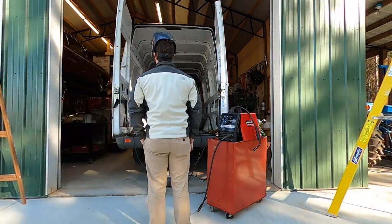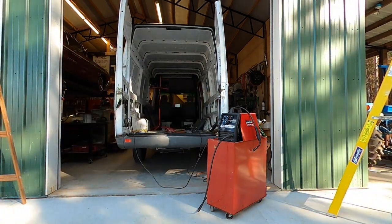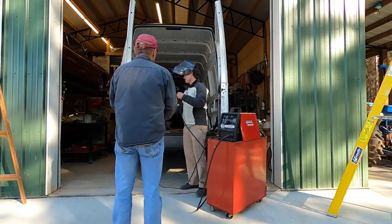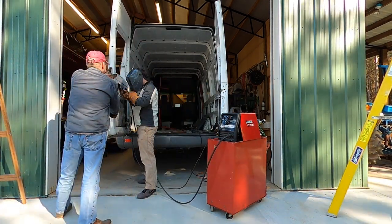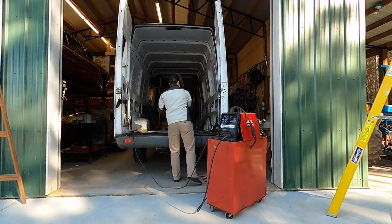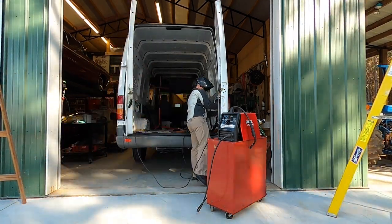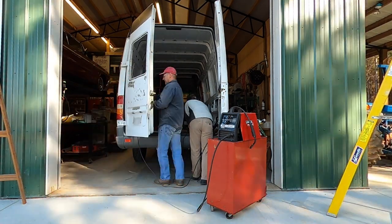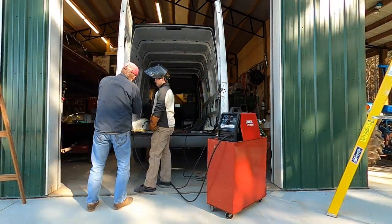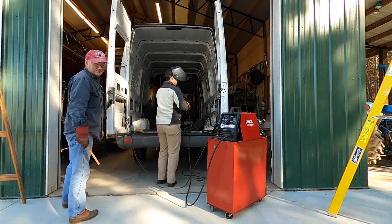Once we got the windows out we moved to reinforcing the doors. Basically the way the doors shut, you kind of have to slam them, and when you do that you tend to push on the middle of the door. There's really no reinforcement in the middle to keep the door panel from bending in, so over the years of being shut over and over the door panel kind of caved in. Since we were doing bodywork and prepping for paint, we decided to weld in some reinforcements in the rear doors, similar to what we did in episode 2 with the sliding door.